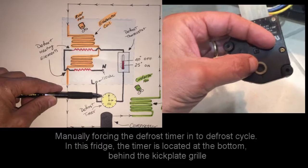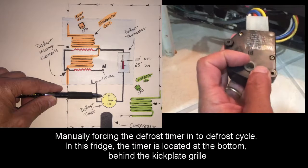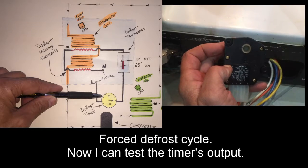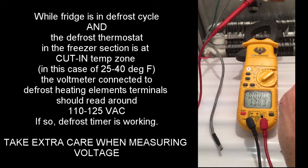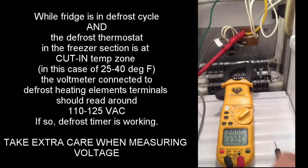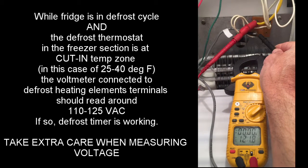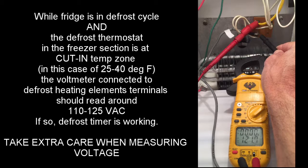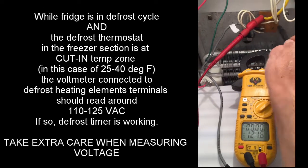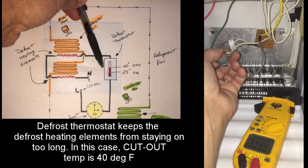They're defective. Next I'm going to put the refrigerator into its defrost cycle by manually turning the knob on the defrost timer. That defrost timer in this particular refrigerator is behind the kick plate. This will allow me to test its output while we are in defrost mode. I'm going to check to see if our defrost timer is actually working by sending voltage to our heating elements. I'm connected to the two terminals that provide power to our heating elements, and I can see the meter is reading 120–121 volts, so that tells me our defrost timer is actually doing what it's supposed to be doing.